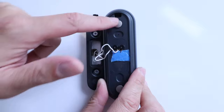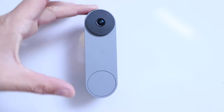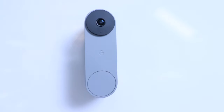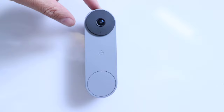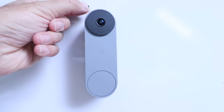To install on the mounting bracket, the top tab goes into that hole and the two lower tabs go into the two holes on the mounting plate. Push in, align on the top tab, then push down to slide it onto the tabs and lock it in place. It may take a little wiggling, but it has a really nice secure feel once locked. You may need to shorten the wires if you've got too much length. Now put the little screw back at the top and secure it.